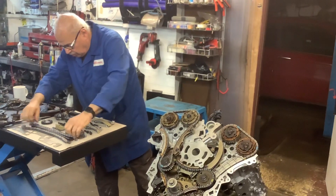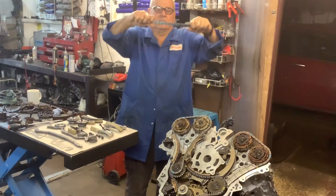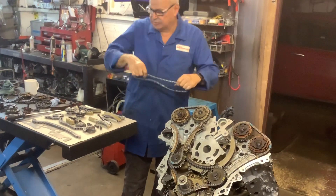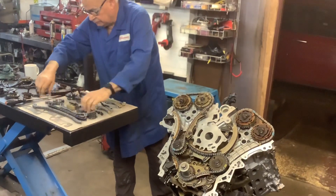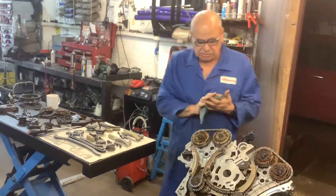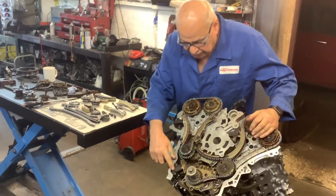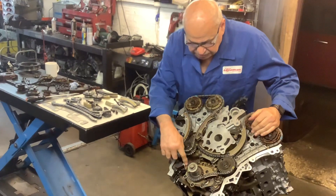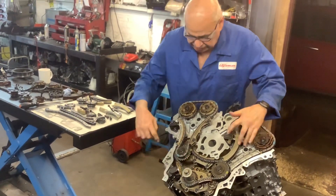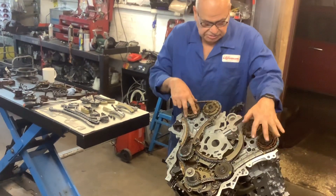Here is a new one from a new kit that we sell. There is no movement in any of these chains — these are absolutely lovely. The engine has three tensioners: one, two, three. This tensioner tensions the crank chain, and these two tensioners tension each cylinder head chain.